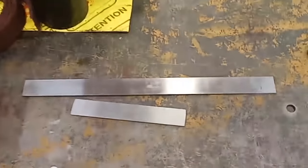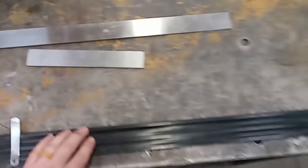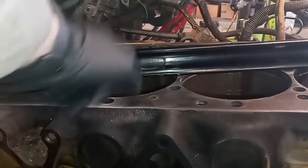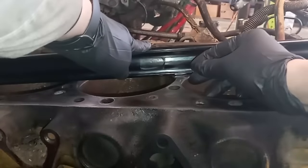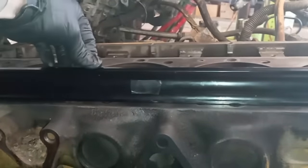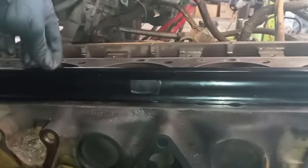These are the straight edges we're going to be using: an 8-inch, a 16-inch, and a 38-inch one. The 38-inch one is anodized aluminum, straight to about 2 thousandths of an inch, which is CAT's spec. What you do is set it on the edge after wiping down the deck surface with brake clean, then take a 2-thousandths feeler gauge and run it under the straight edge in pretty much every position possible. I usually move the straight edge to about six different spots. You don't want any low spots — if that 2-thousandths feeler gauge goes under somewhere, you've got a low spot, most likely something's wrong with the block. If you used the roll-lock wheel, you're probably going to find a couple spots. That's pretty much how you prep them.